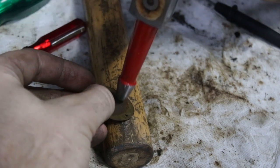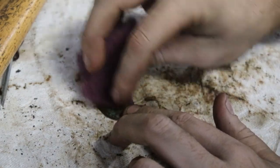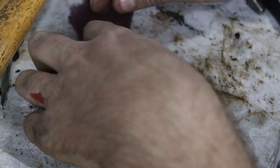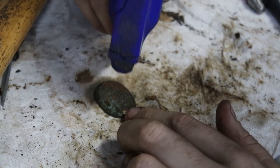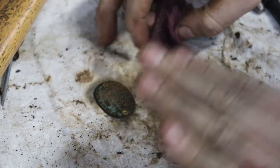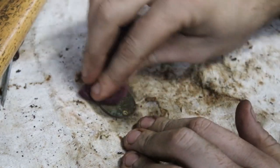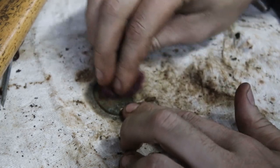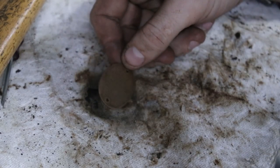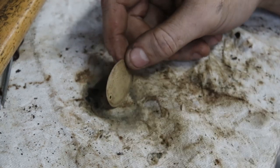I think it's about as flat as I can get it. I'm just going to give it a very light brush over with some Scotch-Brite to remove some of the corrosion. I've put some WD-40 on it as a lubricant — it also stops the Scotch-Brite from clogging up. I'm pretty sure the way this was made in the factory is they would have had a stencil with the logo, placed it over the badge, and used an acid to etch away the stuff not covered by the stencil, leaving the raised lettering. After scrubbing it, it's a Mitsuba Horn — 12 volt, 3 amp, 110 decibels. I might do some googling to see if it's original.